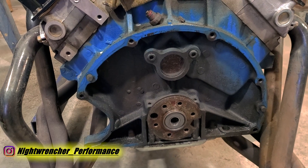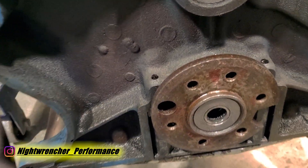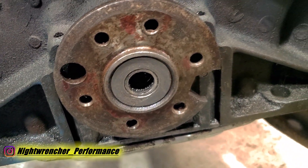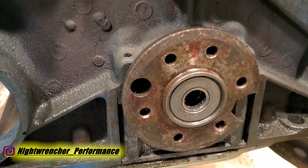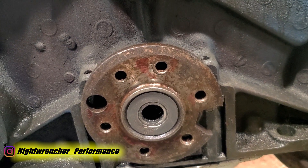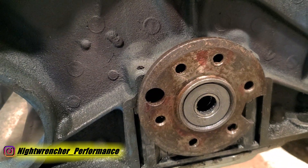I just got the SST off the back of the big block and now we're just looking at the pilot bearing sitting here right behind the crank. Some of you guys might actually recognize this bearing because it is out of the 318 and 360 Magnum engines — it's just a small block bearing that not only fits the pilot on the transmission, but it perfectly fits the back side of the crankshaft. So you don't need to buy any kind of special bearing to get this swap to work.